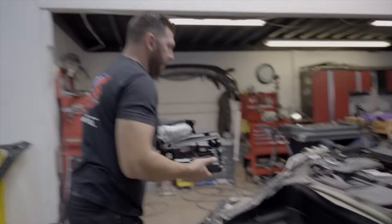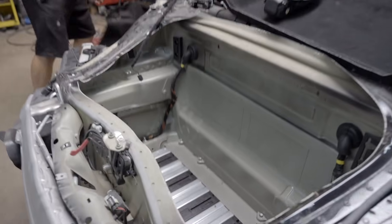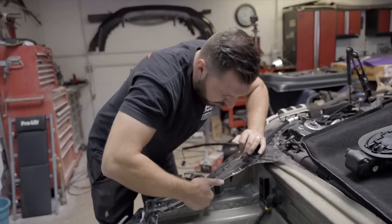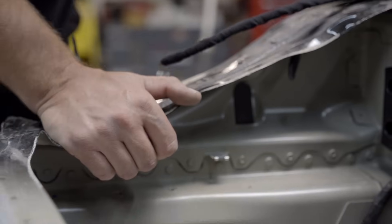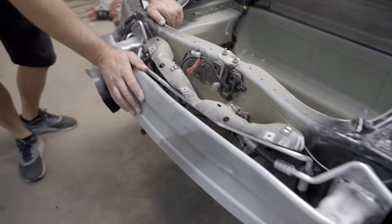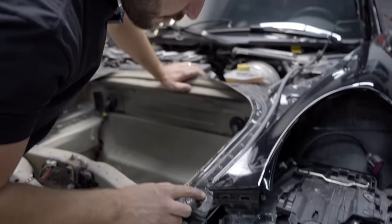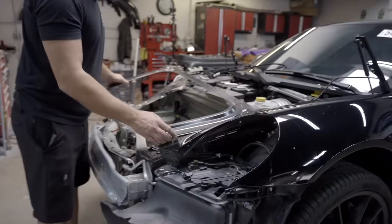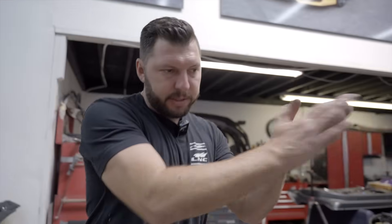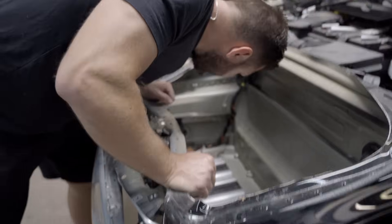Let's get everything out of the frunk. Got everything out. This piece right here — we gotta replace this. That's where that small section goes. I'm gonna remove this reinforcement right now, kind of free everything around this area, and then we'll start grinding this upper panel off. I'm gonna have to pull the fender because this piece goes inside of the fender. Lots of work ahead of us, so let's just dive in, knock this out, test fit everything and we'll go from there.